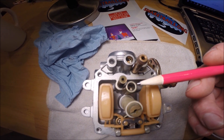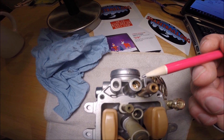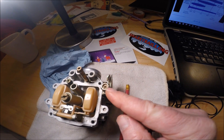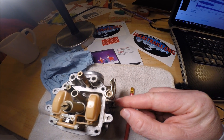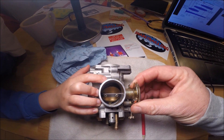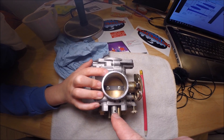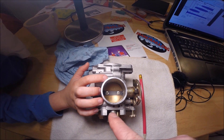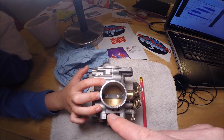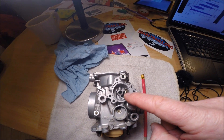Just forward of the pilot jet, located on the outside of the carburetor underneath, is the pilot screw that controls the idle mixture adjustment. Here's your overall idle adjustment — the big thumb screw located on the outside of the carburetor — which adjusts the butterfly valve to set the idle on the bike. Inside here is the butterfly valve that opens with the throttle cables. I've threaded the pilot screw all the way in and counted the number of turns at this stock setting. Note the settings of your carburetor before you tear it apart — write that down for future reference.